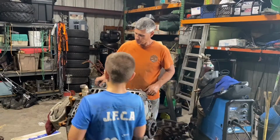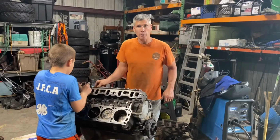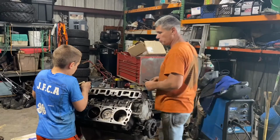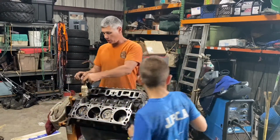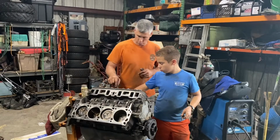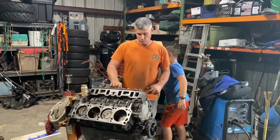This is going to have regular bolt-down style pedestal rocker arms. For now, he's going to buy himself a set of 1.7s to go with this little HO cam. Someday, if he wants to get crazy and spend his money on it, he can buy some AFR heads or something like that, and the little HO cam with the smallest 165 AFR heads can really make some good power.